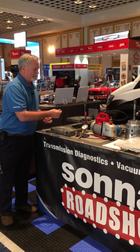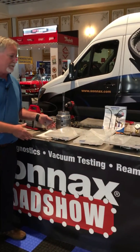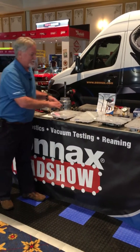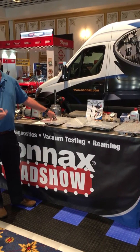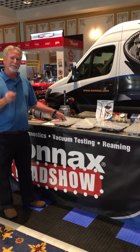Based on the needs of the shop — you guys talking to us — we want to meet the needs of the shop. Last year, we introduced some new vacuum testing plates. These plates cover the entire valve body. Last year we saw the 4L60E family, the 5R55, the NW and S's, as well as the ZF6 speeds.